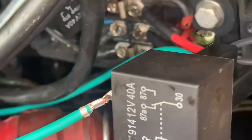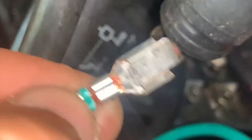I've got to get another quick connect and replace it. Here's the new one — this will go onto that wire and connect, and then I should have an operating tilt trim. I've got the new connector on here. The reason I used this type of connector is because it came with the relay harness and plugs right into it.